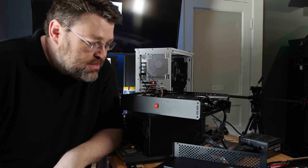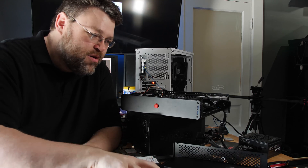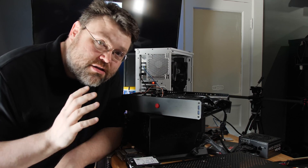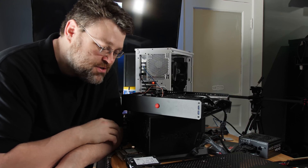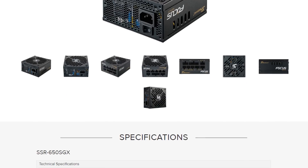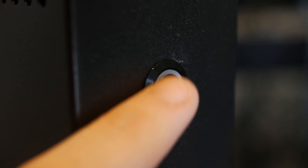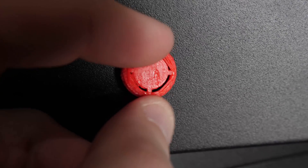I'm sure I still got that pronunciation wrong. Things might seem a bit cramped today because we are working in the land of Mini-ITX and the Sentry 2.0. I've done a lot of builds with the Sentry 2.0 so far, and most of them using parts you're never supposed to use — things like a 14.63 millimeter tall two-and-a-half inch drive and an SFX power supply that's a little larger, 125 millimeters on the side instead of 100 millimeters, so you can't use the attractive button. You've got the 3D printed push button on draft mode so I can print it in black later.